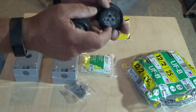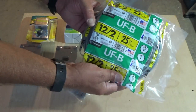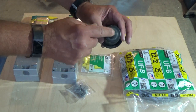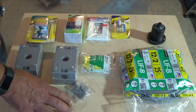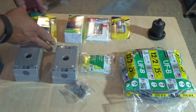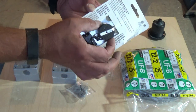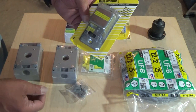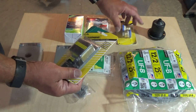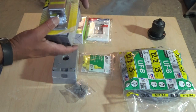All my wiring is going to plug into the back here like this. I did buy some 12-2 wiring, but I think I might switch that out and go with a cord instead of the flat wire, only because the bottom here is round, so it makes sense to put a round peg in a round hole instead of a square peg in a round hole. So that goes on the outside of the trailer. Run my wire in. The next step is it's going to go into a Bussman - a Cooper Bussman. It's a 15-amp fuse block on-off power switch, so if it's overloaded it'll pop the breaker, which is the old-fashioned one of these little 15-amp doodads. From the trailer wire, it's going to go into the Bussman fuse. That'll also be in a little block like this and I'll tie in here.